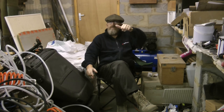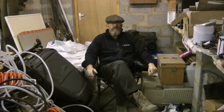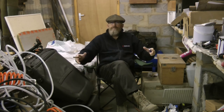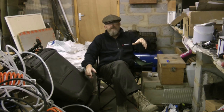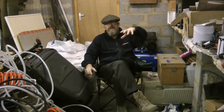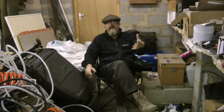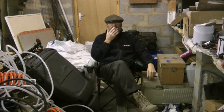And of course, as soon as any pressure was put on that, when I put the holding rail on there, it was going to crack the clear coat. And so I had to take all of that off, even though the rest of the paint was good. That then left me with the problem of merging the two areas together. So I ended up just having to take all the paint off that back panel. And it was after that that I then started to have problems with the back panel and contamination. And that was coinciding with the weather getting colder.